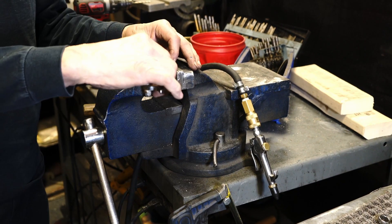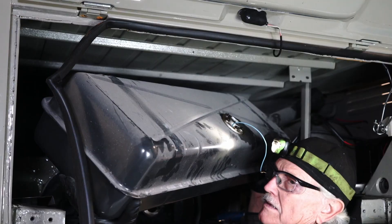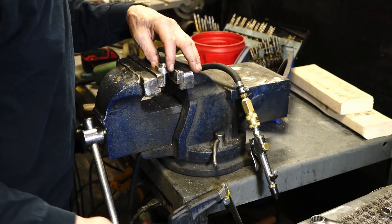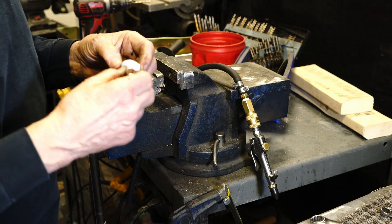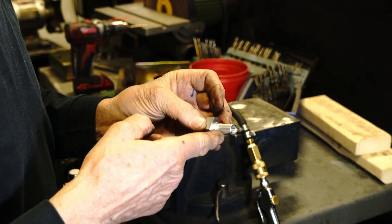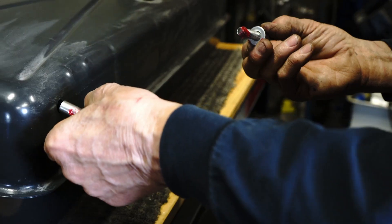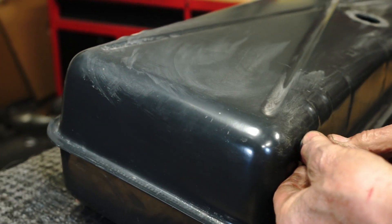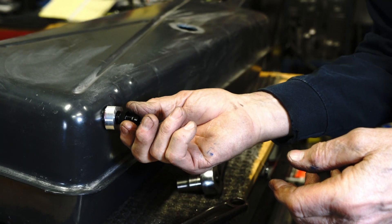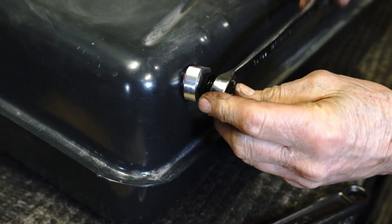Now it is time to install the easy return bung into the gas tank. The easy return bung comes standard with the force fuel mini. The gas tank has been removed and cleaned out to remove any type of fuel or fumes inside of it. We're going to drill a 3/8-inch hole into the gas tank somewhere high up on the edge of it, and then install our easy return bung into the side of the gas tank. Using a little bit of grease on the threads, be sure to fully tighten the bolt while holding the bung onto the gas tank to ensure a proper seal. Once installed, do a pressure check to ensure an airtight seal.